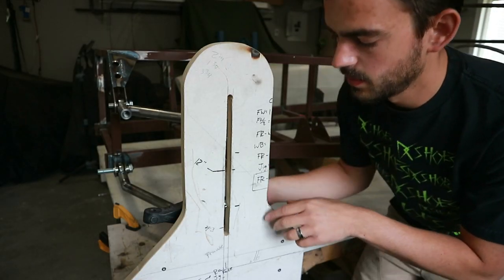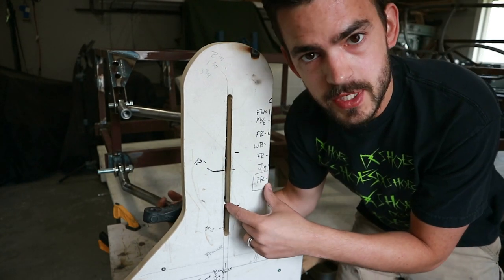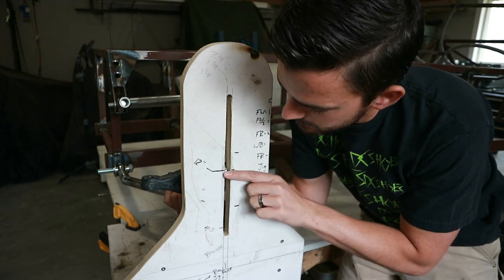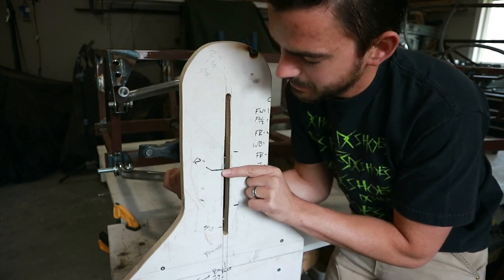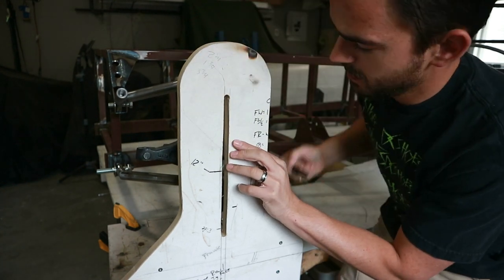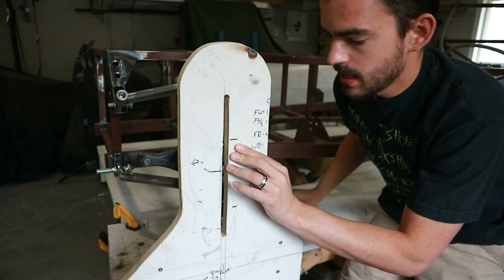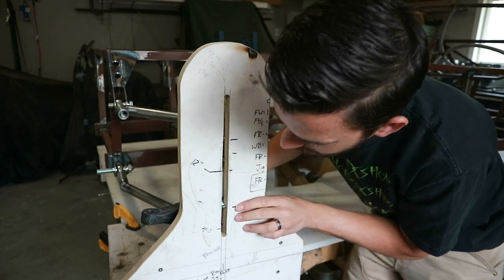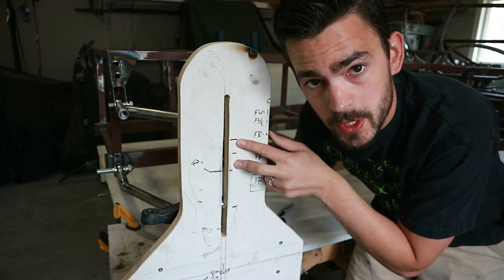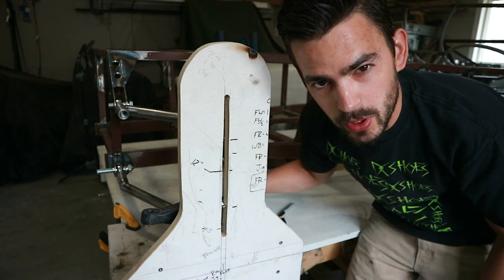With those arms mounted, we can run our spindle through its full motion of travel and use this pointer to see what our max travel is. Ride height is right there, maximum up travel is about there at full ball joint bind, and maximum down travel is down there at maximum ball joint bind. This isn't very much up travel — may be enough down travel but definitely not enough up — so we need to look at where those ball joints are binding.